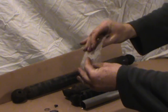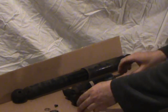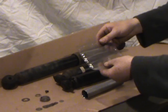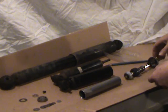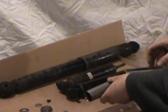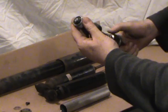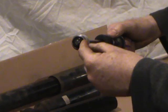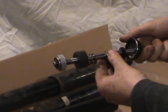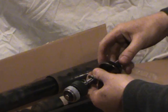It's full of shock oil — a very lightweight shock oil. This airbag actually installs inside the shock with the rest of the assembly following in behind, but for today's demonstration I'm leaving that out since it would just get crunched unless done properly. Essentially it's a plain, very smooth cylinder inside, and the rest of the action slides inside that tube. Now what we have here is a piston — it actually has a bleed in it so oil can travel in and out, but it's not too free-flowing. The rest of this is packing material, a spring, a conical washer, and a packing washer to keep the fluid from escaping as the shock moves.